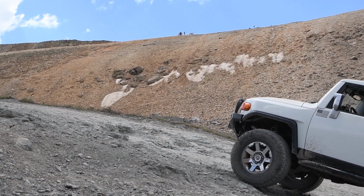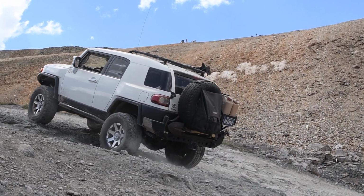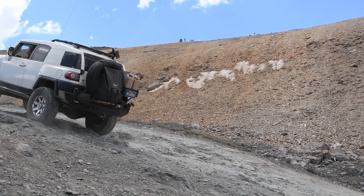And so the engine coupled with being geared has definitely done some advantage. And what gears are you running in? In the rear, 456s front and rear. The rear does have that factory E-locker, which is beautiful. Front, since I was in there, I ended up going with the ARB air locker, which again this weekend has come in super handy. And being able to turn it on and off, because I don't know how your truck is, my 4Runner, when that locker's on, you can't turn the front wheels.